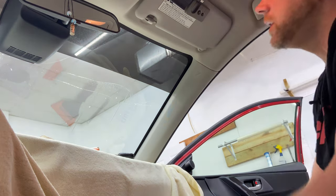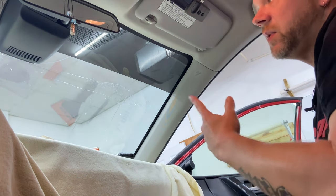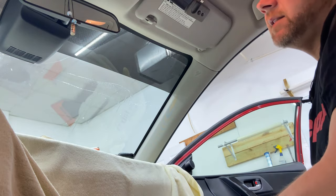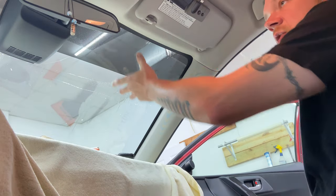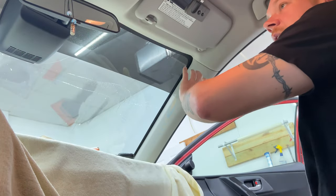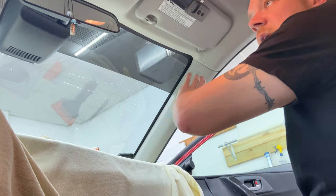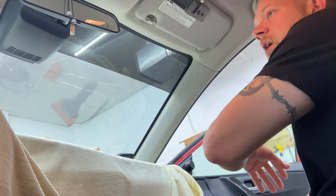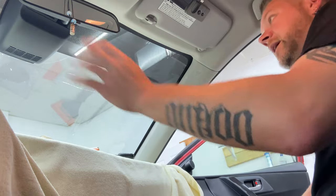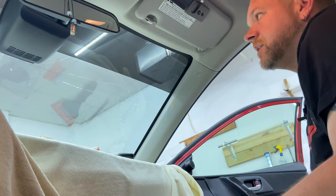I'm going to wet the window. The sun strip is still sitting on the glass. I'm going to peel it from the windshield, spray it, and bring it in. The difference of doing two strips as opposed to one solid strip is you're going to clean one time all the way across, squeegee it off, get it prepped, then wet the glass, peel the entire sun strip, and bring in one whole piece. That's really the biggest difference. It doesn't take much water.